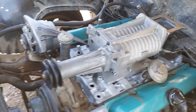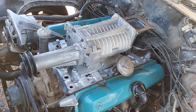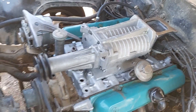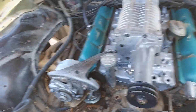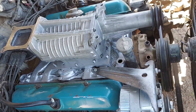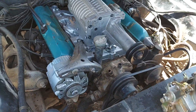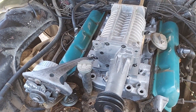When I get this engine running, I'm going to run a wideband air-fuel ratio gauge on there, because you always want to keep tabs and make sure you don't run lean — especially at full wide-open throttle. That goes for whether it's carbureted or fuel injected. I've boosted several engines before, blown a few, and learned you need to monitor AFR and make sure the engine doesn't ping, knock, or detonate.